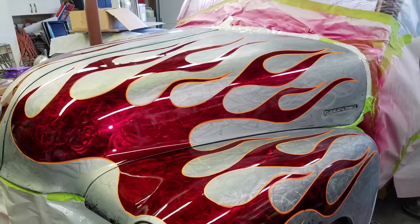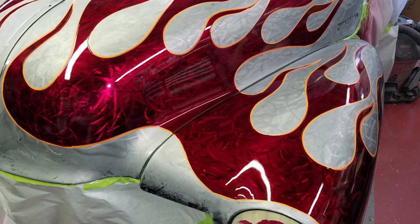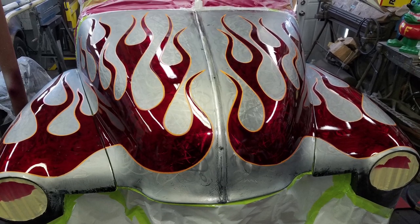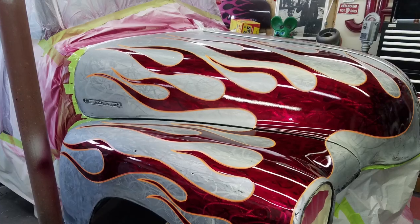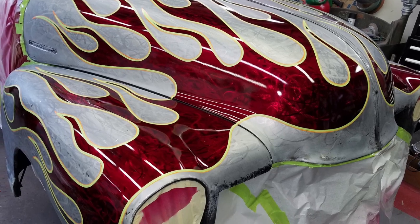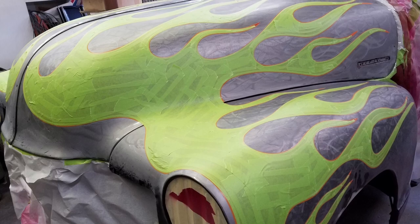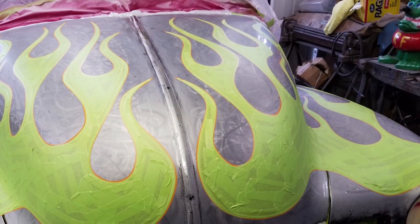The tape was ready to come off, and for the first time I got to see the red against the rest of the truck, which was bare metal and actually looked silver. It was a nice effect, but I couldn't leave it like that because the rest of the truck had to be painted. So I had to start reverse-taping the flames, again starting with the quarter-inch fine line tape, going to the three-quarter-inch tape, and then into the two-inch tape. I'd suggest always having an X-Acto knife with you because it always comes in handy. Finally, the flames were covered and protected, and the preparation for painting the black began.